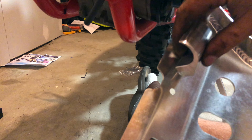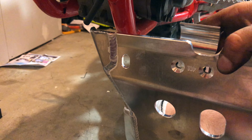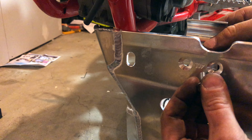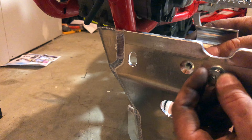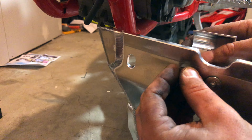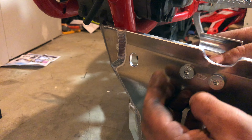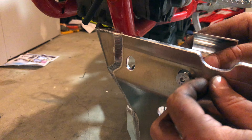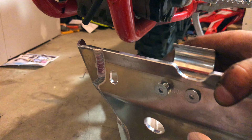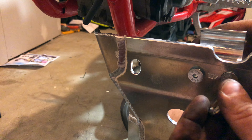As you can see here, we're going to take this, flip it around. Then we're going to hand-screw in these bolts. And again, no threadlocker — at least according to the instructions. If these things come loose, I'll check them after a few hundred miles and take care of it. These are going to be five millimeter Allens — let me make sure of that. Yep, five millimeter Allens.